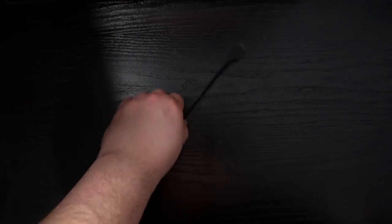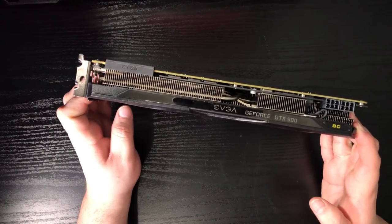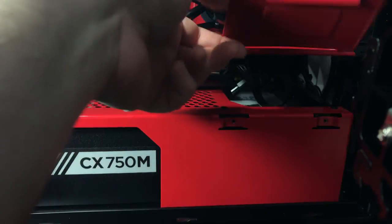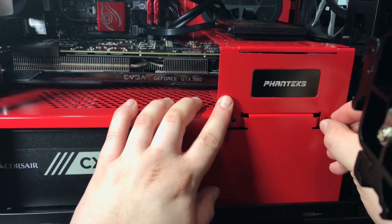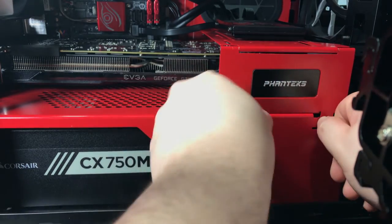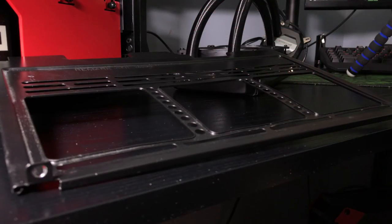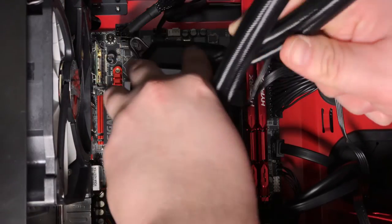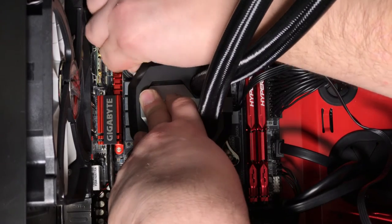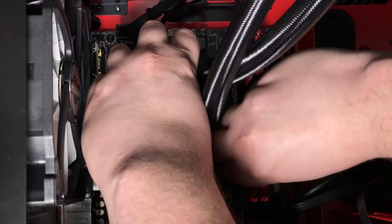We're going to need a cable for the storage drives and the GPU. Speaking of GPU, now's a good time to put it in the system. Lastly, we'll install the Corsair H100i. This case has a radiator mounting bracket that makes installation a breeze. It's good to remember when screwing down a water block or a CPU heatsink to turn the screws in a star pattern — starting from the top left, bottom right, and so on — so that you get an even pressure while mounting.